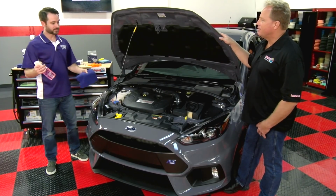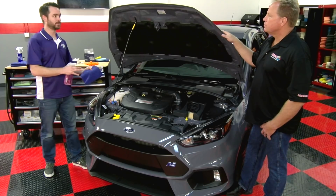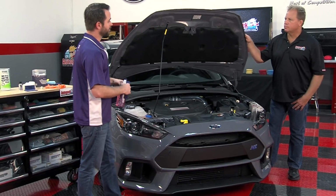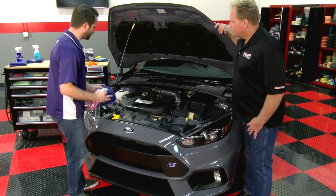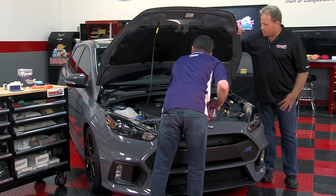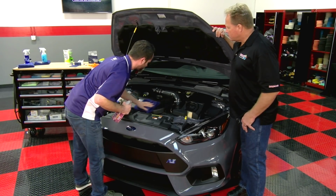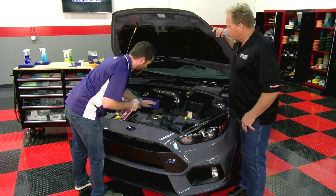Yeah, definitely. So Prep is my go-to wipe down for everything. You always want a clean and pure surface before you introduce the long-term coatings. So any silicones or cleaners or degreasers, you want to be free of the surface so that that plastic can interact directly with the trim and get the most performance and protection out of that. So directly on, I always want to do a cool motor. Obviously let that thing cool down so you're not evaporating out the product too quickly. Just a quick wipe down of the trim. And so what this does then is it preps the plastic surface so the coating can properly bond to it. Absolutely. Anything in between that coating and the surface under it is going to lead to less durability, less performance, and we're going long term with our protective coatings.